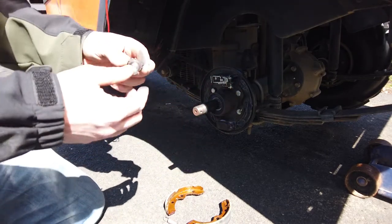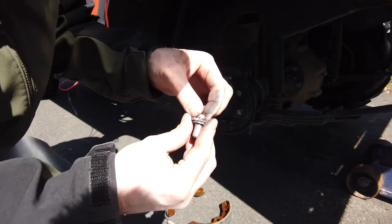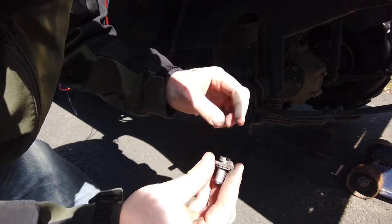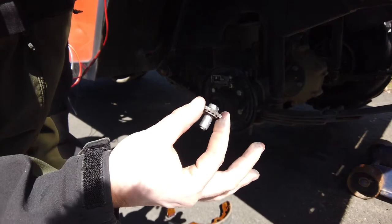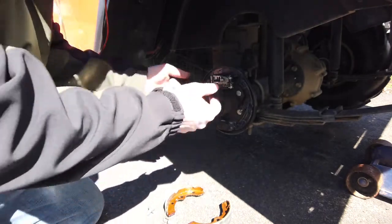And then you're gonna want to fully dial in the adjuster right here. There's a screw right here. You want to put it all the way in, and then you actually want to pull it 1 to 2 turns out, okay? And that's basically what you want to do with the adjuster. There's not a whole lot to this. Don't go nuts. Don't kill yourself. That is important though, so make sure you do that part. The rest of it is fairly simple.